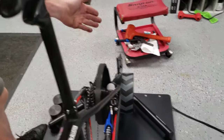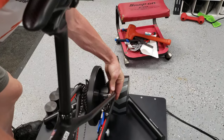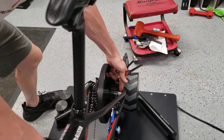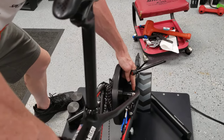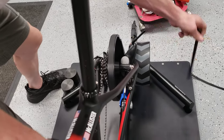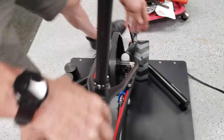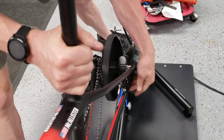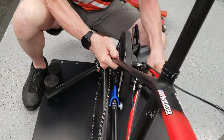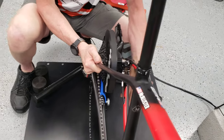Now that's ready to accept the bike. Since everything is kind of floppy, I'm holding the left side in the air, starting with the right side, then guiding it down and aligning it because it's not captive and not well-supported initially. Guide it and align it to get it started, then set it down on the dropouts and thread your axle in.